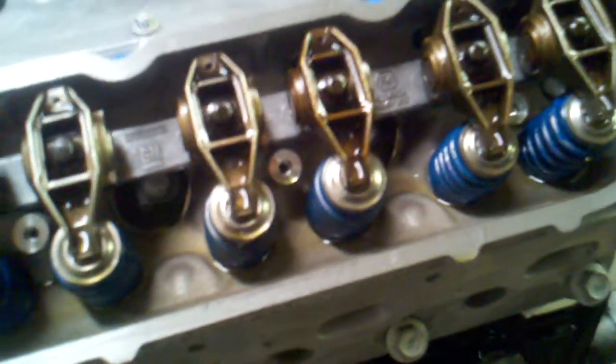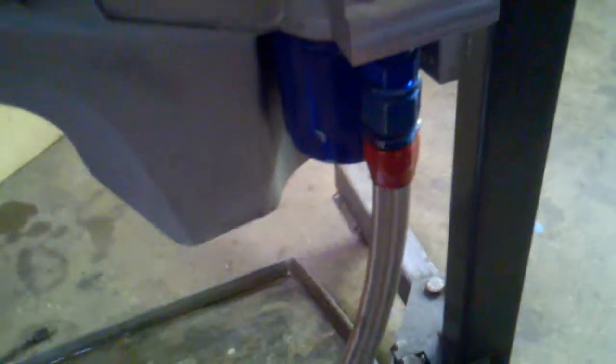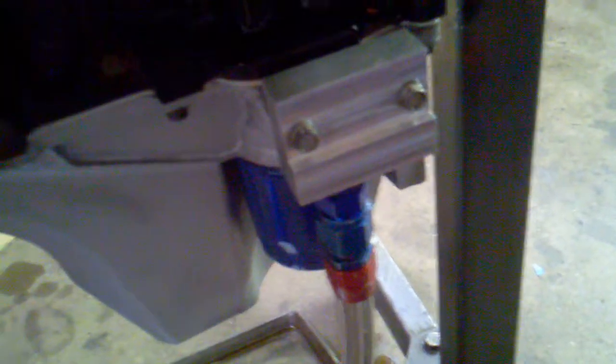I was running it and running it and a lot of oil was coming out of this AN-10 line — just blowing through there like crazy. I looked at the rockers and nothing was coming out after a good five minutes. So that bypass in the original oil gallery line is some sort of restrictor. I machined a restrictor on the lathe inside this fitting — I drilled it out to 100 thousandths. Oil still comes flying out here in big volume, however I know I'm getting oil to the upper end now because I can see the push rod holes and rocker arms filling with oil.